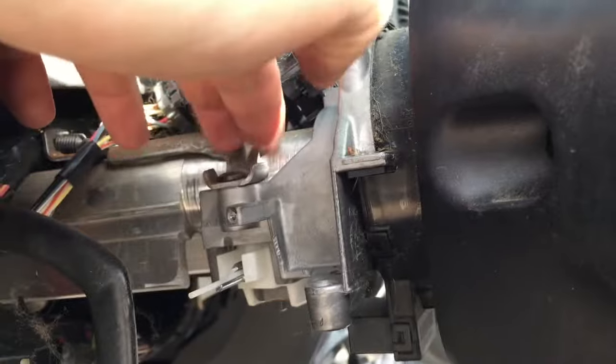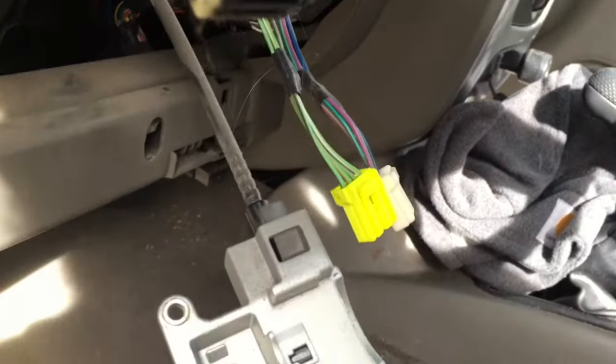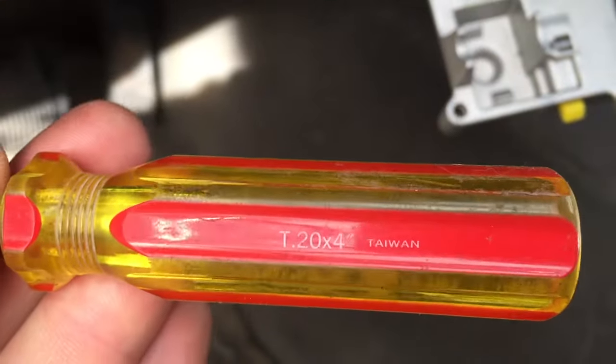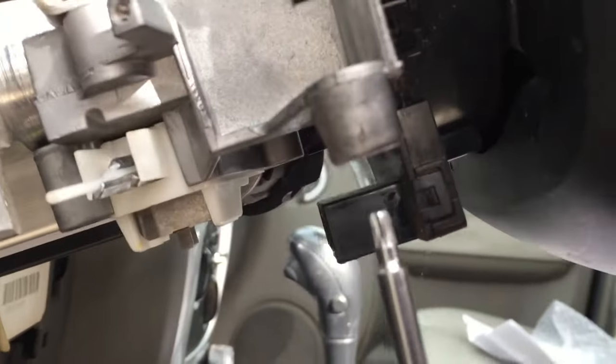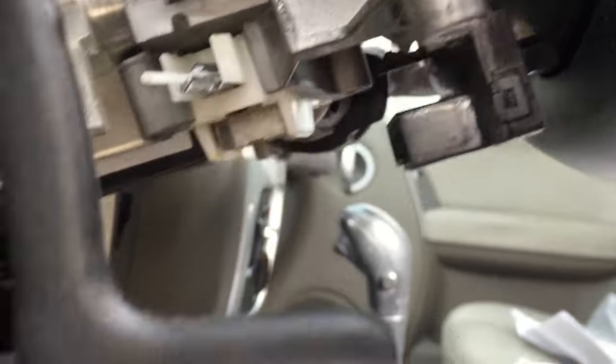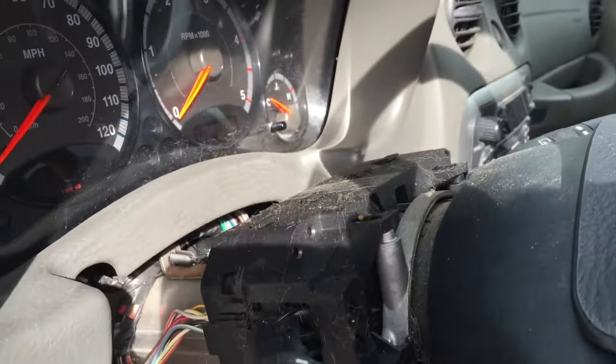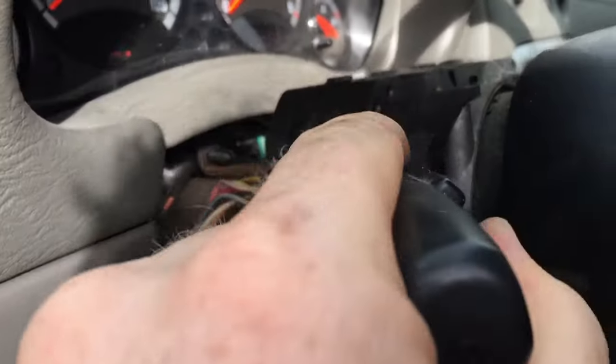The plastic that goes above and below the steering column mounts in with two screws — that's a Torx 20. It's dark up in there, hard to see, but just those two and then that plastic will come out of the way. The top piece will also come off — it's just held in with those. You don't need to get your turn signal assembly switches up; these will just lift up once you've unscrewed the bottom plastic and taken the top off.